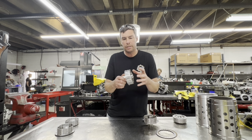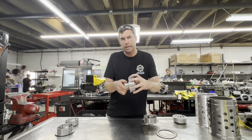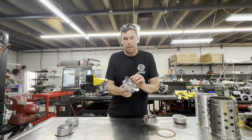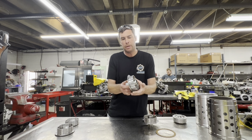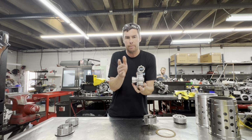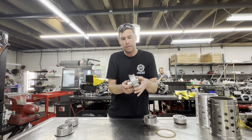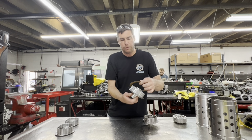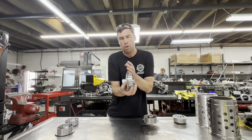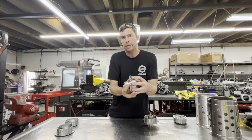It has narrow bushings, and there's wasted space here in this splined area of the hub. So this space, in order to add frictions and steels, you have to put a steel here that's fairly thick, or it'll distort on you and cause some issues with contact with the friction. So you put a steel in here, you put the friction, and then you add frictions and steels to this assembly. The more frictions and steels you add, the more torque capability this hub can handle.